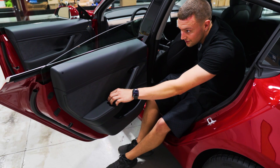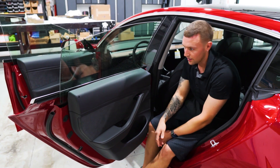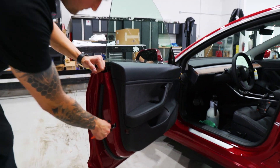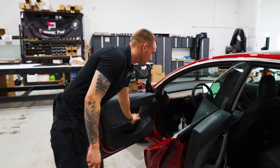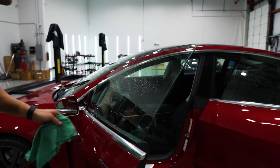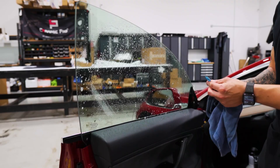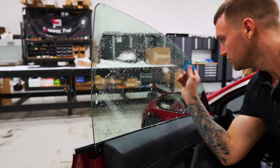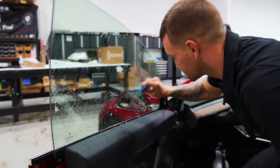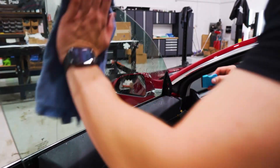Now you can bottom load the tint without the gasket putting pressure on the film and popping fingers up. We'll trick the doors so the windows stay in the fully up position and make sure they're fully up. With the gaskets out and windows rolled up, we'll do the outside prep — wipe the outside of the windows and the bottom section of the door. Then a quick inside prep: soapy water, use a one-inch razor blade holder with a fresh carbon blade to remove any adhesive or residue on the glass. Wipe it down.